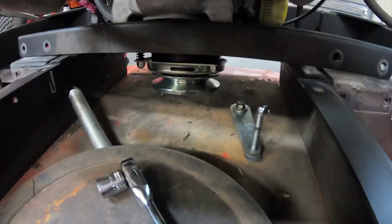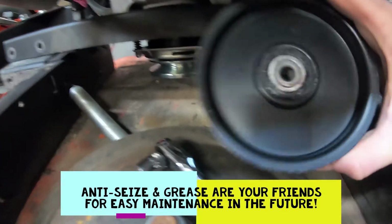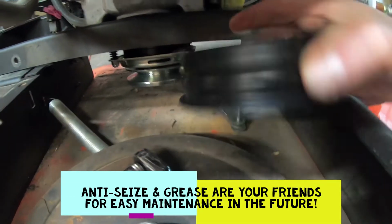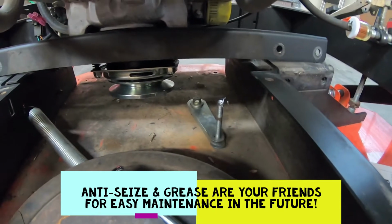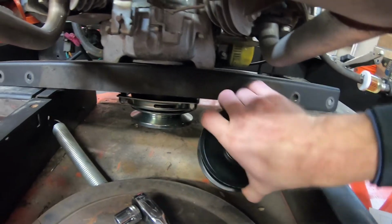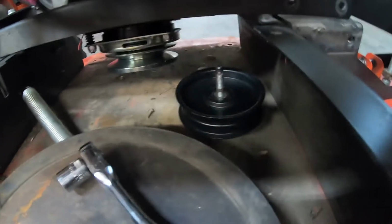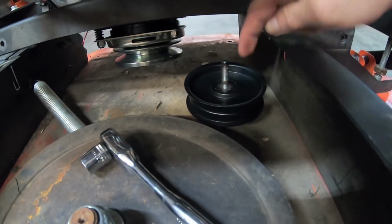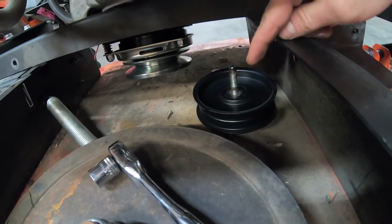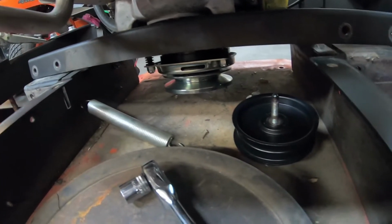We've got the idler pulley arm installed. This is our new pulley. We showed the part number earlier. Put a little bit of grease down in there, and then we've also got some grease and some anti-seize there on top of that bolt. But we're just going to drop it on top, and then we'll have to get us a wrench underneath the bottom and put the 2 nuts on top, because the order goes a nut, spring, and another nut on top. So we'll show that when we're done.